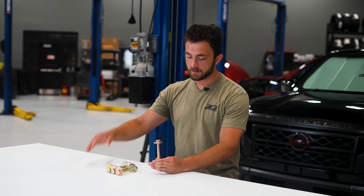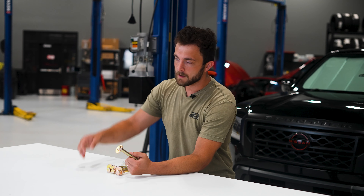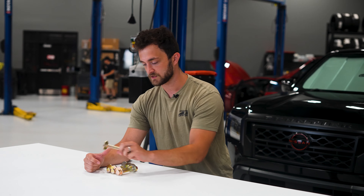If you are running a lift kit, a lot of times we recommend an upper control arm to get a bit more adjustability to fully get out that positive camber, but this will get you a little bit closer.